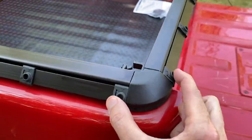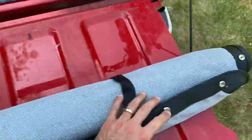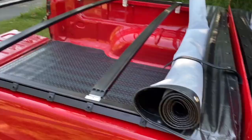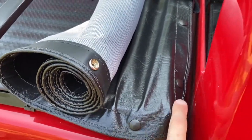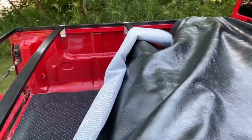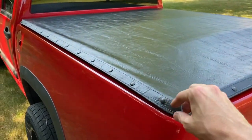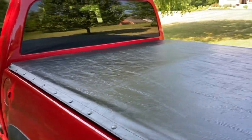Check all corners to make sure they are flush. Next, unwrap your cover and figure out which side is the bulkhead and which side is the tailgate. In our case there is no logo, so that's the bulkhead portion. Lay the tonneau cover up against the bulkhead. The very first thing to do is snap the corners — just two on each corner. Carefully roll it over the crossbars — having a second person help you unroll it would be helpful. Then carefully realign the bottom snaps and secure all of your snaps.